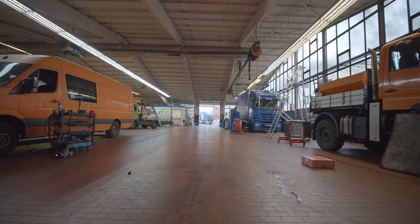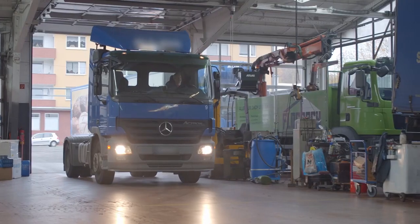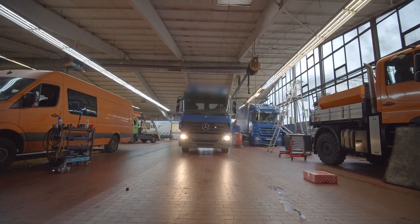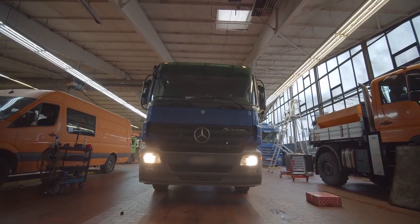The wear of friction brake parts can vary due to traffic conditions, vehicle load, climate, road surface, and driving style. These standard wear parts are safety critical and must be checked regularly according to the manufacturer's recommendations and replaced if indicated. Please note that brake pads, as well as brake discs, always have to be changed as an axle set and not individually.